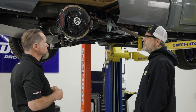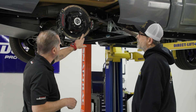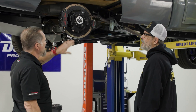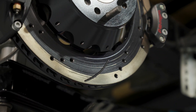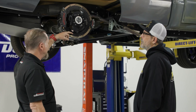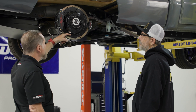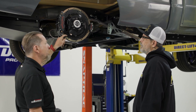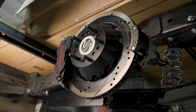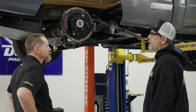But other than that, I think it's a fantastic product. Another question that people always ask is, hey, what's going on with my rotor? This has been a project that you've been rolling around the shop, and what's happened is the annulus, or the swept area, is where the e-coat finish — which is like a black paint — is going to come off where the brake pad rides. So I can't fix this? I can't drive around with a can of spray paint and touch it up at every show? No, unless you want to have somebody do that for you.